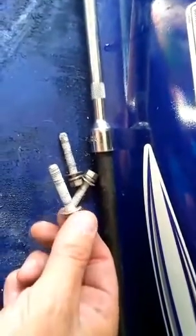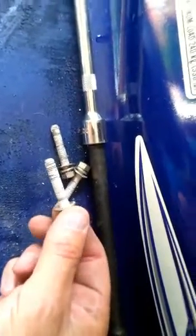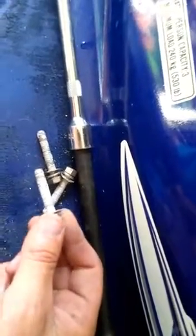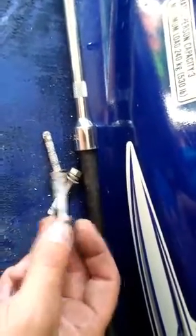It's not a very difficult process. But what you're going to do is get those 12 millimeter bolts off. Once you do that, pull the bolts out. Now these are the 3 bolts that I had taken out originally. You can see all the corrosion on there. Even if you soak these, with all the threads clogged up like that, it would just be very difficult to get them out either way. So again, I would buy new parts, but that's up to you.